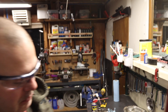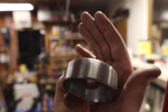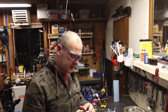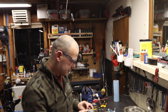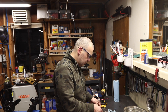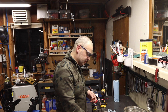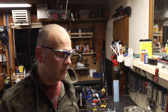I'm almost there on the race. You basically go until you're just about to lose the letters stamped on it. I can get it in and out, but sometimes it gets hung up, and I don't want that happening when I'm setting things up. So I'll take a little more off tomorrow — it's getting too noisy and it's late. Same with the bearing on the other side of the carrier: it'll go on, but it's a little rough. It's fine if everything stays the same temperature, but with temperature differentials, I'll take a bit more off. And I still have to do the other bearings — it's a lot of work.